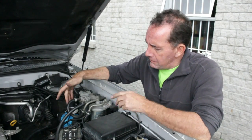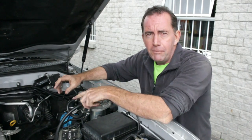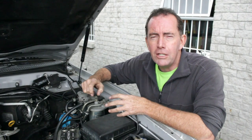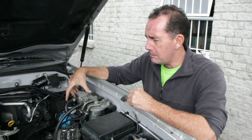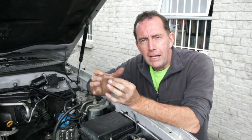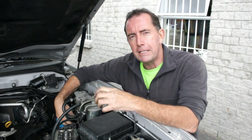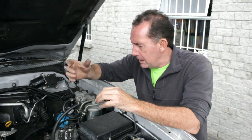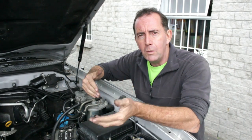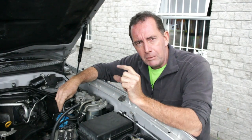The filters are cased here. This particular vehicle has got two filters — two elements — basically a dual fuel filter system, which does a lot to keep the fuel clean. Once the first one blocks up, you'll need to change it and possibly the second one too. At the bottom of this main fuel filter, there's a little butterfly you can undo to let a little fuel out into a plastic bottle, to check whether water or sediment is coming through.